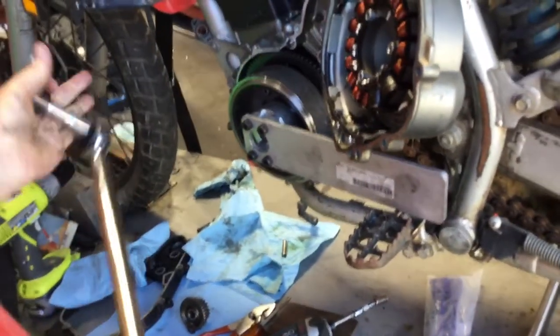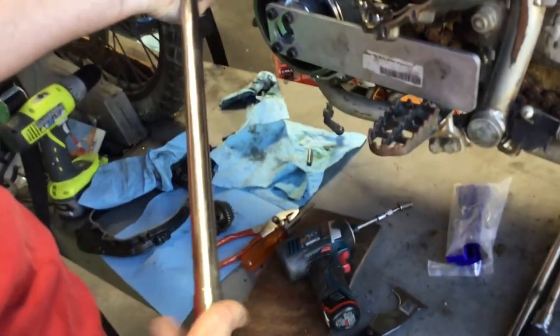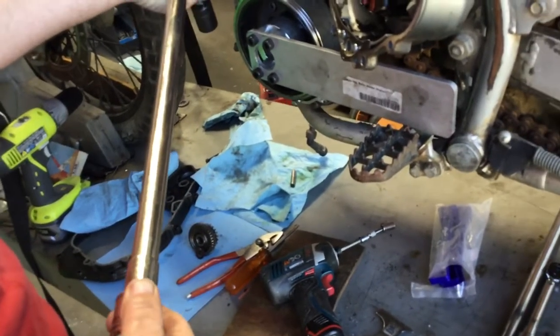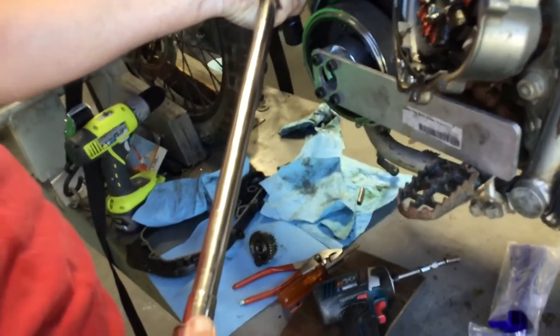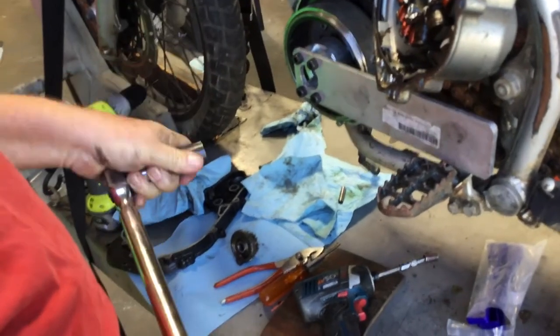Another quick note on torque wrenches. Don't use the bottom 10% or top 10%. I get a call from guys all the time saying they used a Harbor Freight torque wrench that stops at 150 foot-pounds and they went to 144. Well, guess what? You probably over-torqued it.